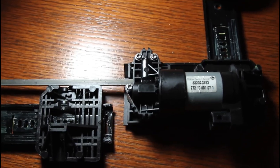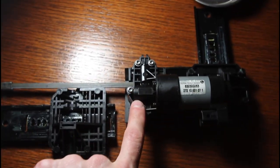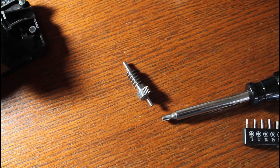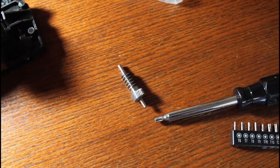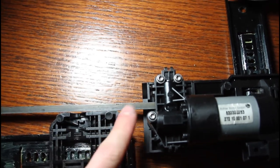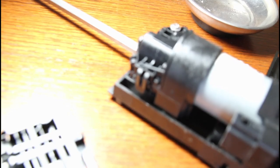The failure point of this unit is right inside here where a plastic gear strips or cracks in half. There is a one-piece full metal design replacement that you can get off of Amazon or eBay — I'll have it linked down below. To begin disassembly, remove the T20 screws from the unit and then there are tabs on the side right over here. Remove all those tabs and then you can lift this plastic cover right off.